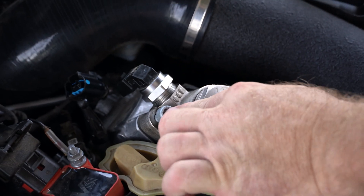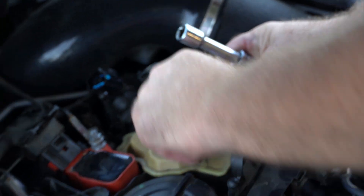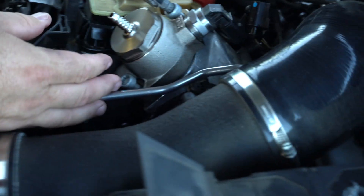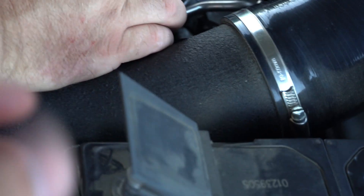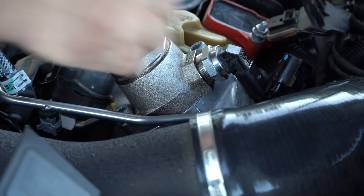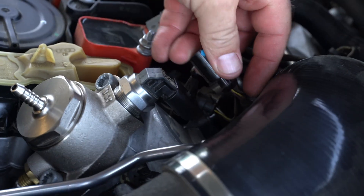Now we're fastening it down - put the 10 millimeter triple squares back in. The pump will set down in place, and since there's no pre-tension from the factory, all the spring pressure comes when you put it back on. Snug it down with those two bolts to apply pressure and seat it correctly - it's a ball fitting so it swivels. Then put the electrical clip back on and do the fuel line.